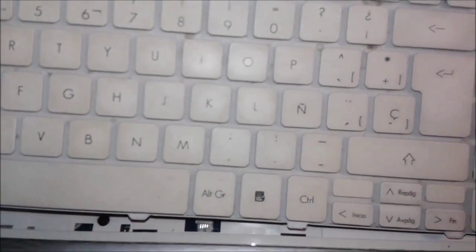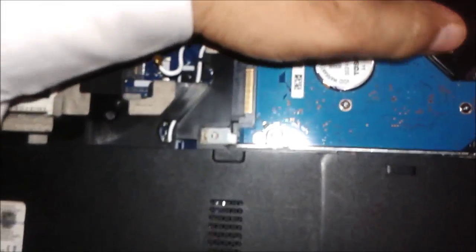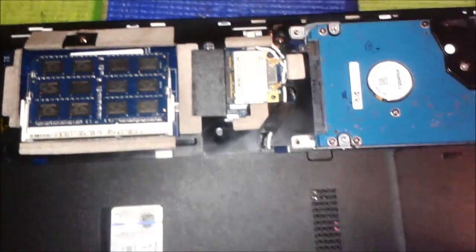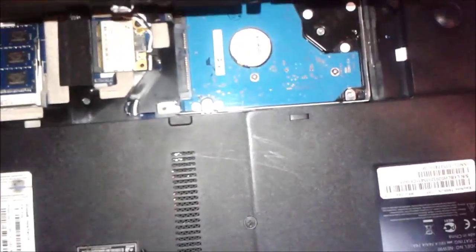The Packard Bell is almost closed back with all screws back already. On the bottom side, the CD drive is plugged in, and the hard drive I'm going to plug in again — just push inside. The wireless card place — put back the wireless card first, then cover it up and screw back all the screws. Almost all screws are put back. This is the last cover — push down the small clips and it's plugged in. One, two screws here and three here — that's it.